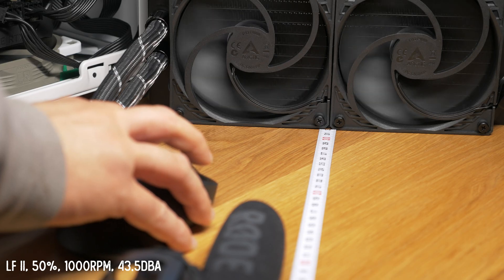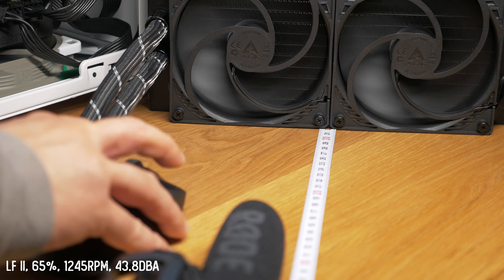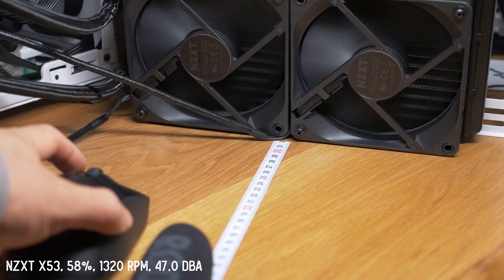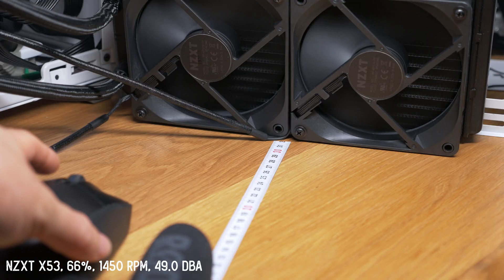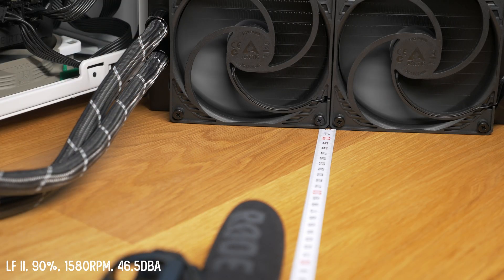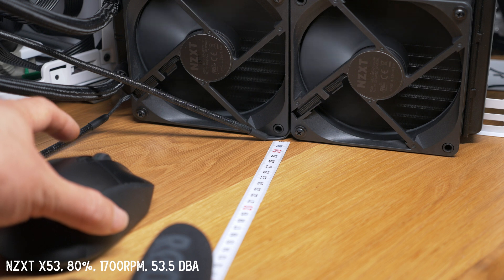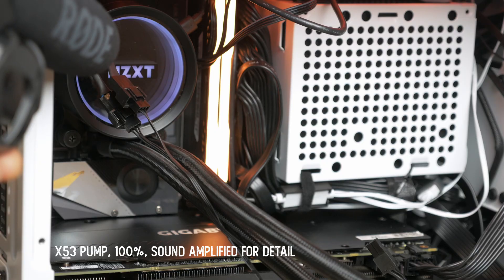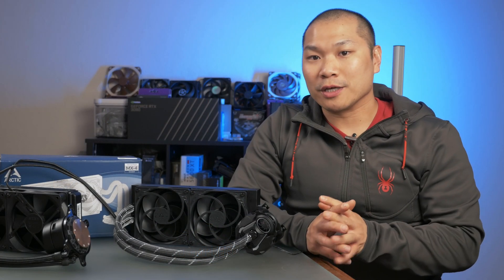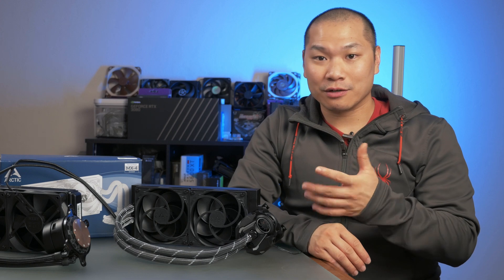Here's a quick sound sample of just the vast sound difference of the two units at equal RPM levels. At around 1200 RPM, the P12s did exhibit a little growl or howl, but overall the P12s are really great performers as radiator fans.